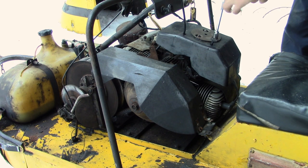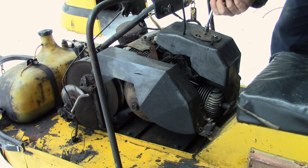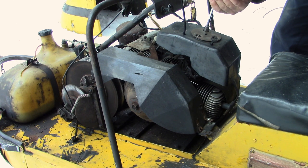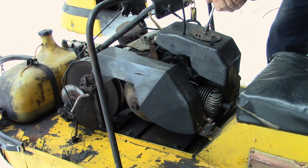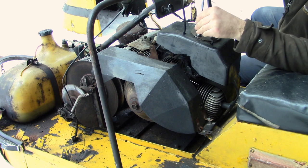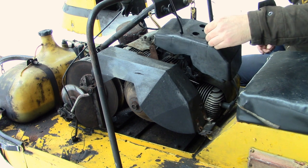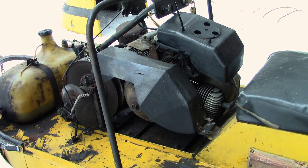All right, so I guess we'll start by getting this air box off, to give us a little bit of room to work. Got some loose fasteners. I'm not sure how it's held on at the bottom, but this is the first time I've worked on an opposed twin cylinder engine, so pardon me if I don't seem at ease with what I'm doing. This comes out here. Check and see, and then this guy. Choke, I don't know if that just pulls off or what. I'm gonna try not to damage this air box. Might be the most valuable part on this sled.